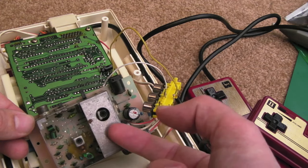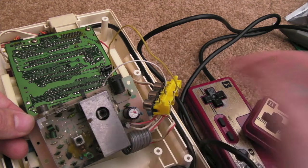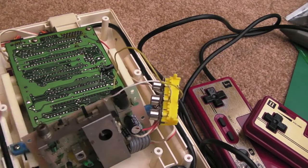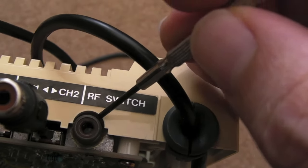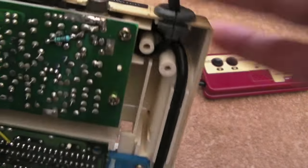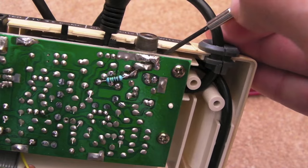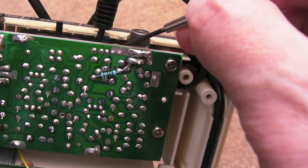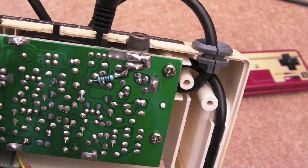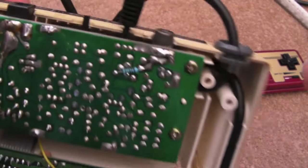While I'm here, I'm going to replace the 1000µF cap and the 1µF cap on the regulator board. This gets really hot with the Mega Drive power supply — the same issue as my PC Engine — so I'd recommend using a dedicated 9V DC power supply. I'll use the PC Engine's one for the moment and order another dedicated one for this. I also had to put a tiny bit of solder to hold the metal part of the RF connector onto the surrounding shielding, because there was a hairline crack all the way around it and the ground was loosely connected — that was one reason the picture was so fuzzy.